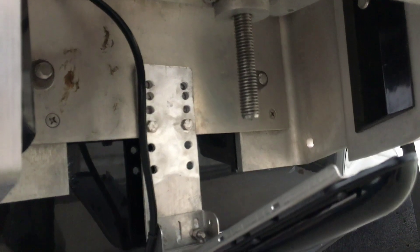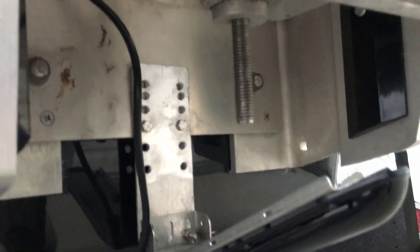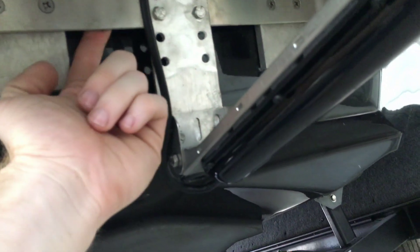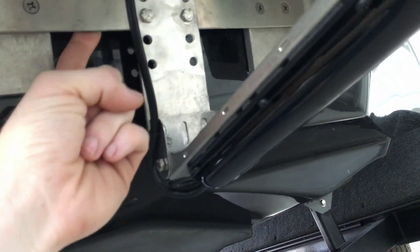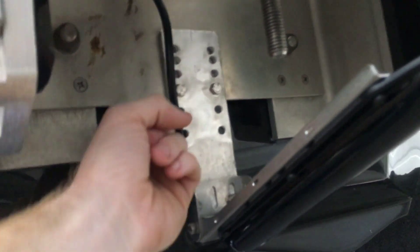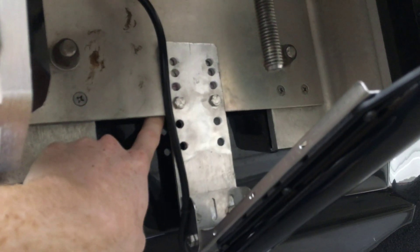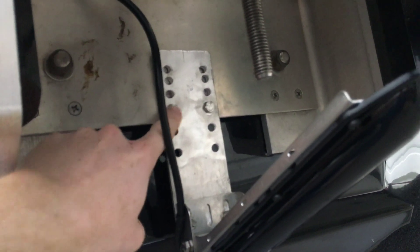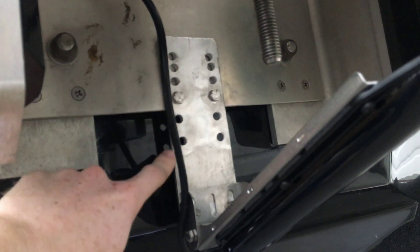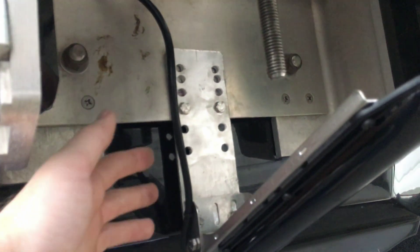I'm going to get down here so I can show you guys — and there it is. The wire is coming down and I have a little piece of aluminum that I cut out. It's not beautiful, but I cut out a piece of aluminum and attached it to the jack plate. There's about a finger's width of clearance right here between the fiberglass and the jack plate. I put a piece of metal behind here and drilled two holes for these bolts, so that when it went through it didn't touch the fiberglass. I mounted this piece with multiple settings depending on the depth because I didn't really know where exactly was going to work best, and I'm still testing this out to see what's going to provide the best performance.